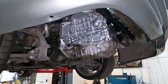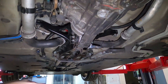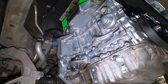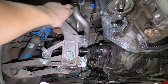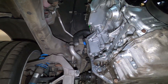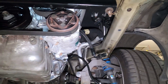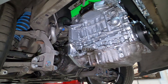Engine is in. We've started bolting things back up — the engine brace is bolted up, the front brace is bolted up, and we've started bolting up the drive shafts. The shifter linkage is all bolted up, the clutch slave cylinder is installed and connected, and now we are working on figuring out the cooling system. The Porsche setup has these aluminum lines that run to the front of the car and we're figuring out how to best connect the Honda engine to those original coolant pipes.